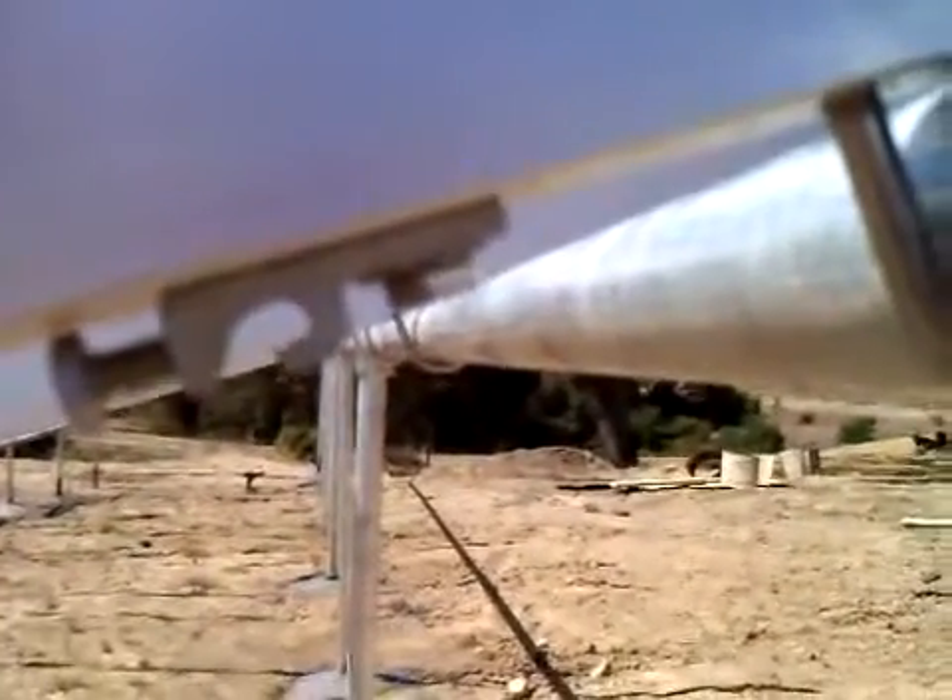So make sure you cut the holes and make sure they're at least three inches away from the U-bolt. Why? Because on the inside of the U-bolt, as I come up here to the top of the rail, you can see that there is a strapping that goes beyond the edge of the U-bolt. I mounted them about two inches away from the hole where the U-bolt was, and it was just enough, but it was still pretty close to that strap. So make it about three inches if you can.